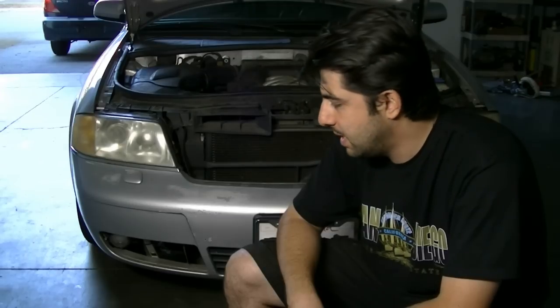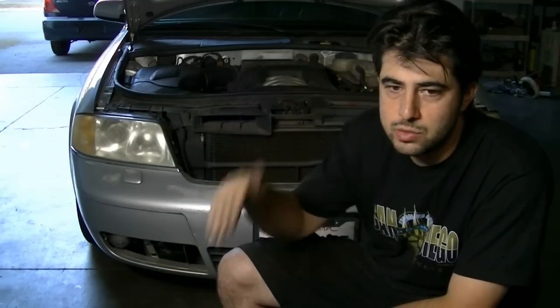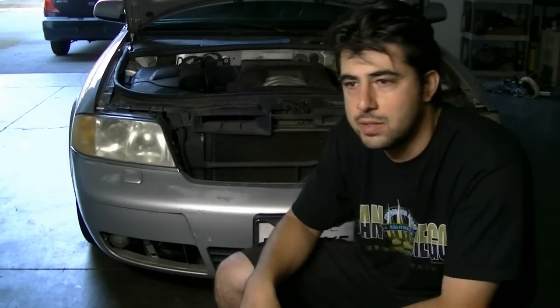Something to make note of is that this is the third engine oil pan replacement I'm doing on this 2.8 liter engine made by Volkswagen. These engine oil pans are just way too close to the ground, and whenever people go into a dip or go over a bump too fast, they scrape the bottom of the engine oil pan, which is made out of aluminum — a softer metal — it cracks and you get an oil leak. If you have one of these cars, make sure you don't go into any dips too fast, and if you do, pull to the side and make sure you're not leaking. If you get a big leak and all the engine oil drains out, you'll run your engine and then you'll be looking for a used engine instead of just replacing the oil pan.